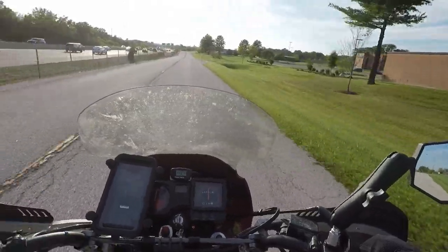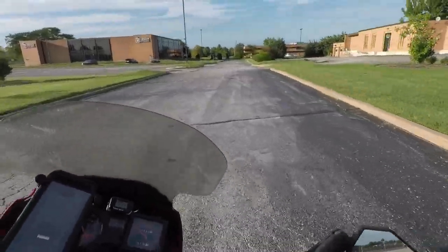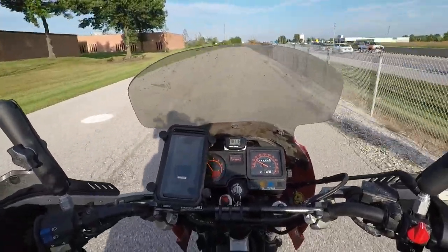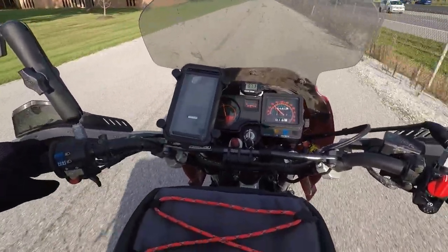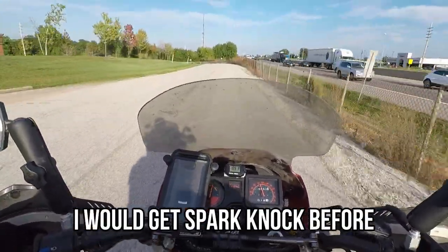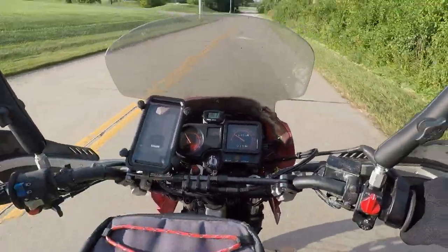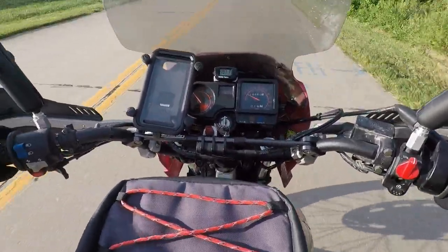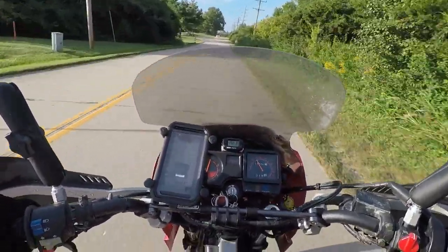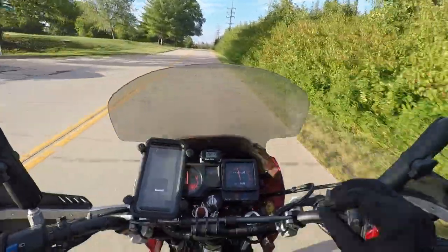That roll-on power actually feels a little bit more smooth. So KLRs don't like being lugged. That is much better. All right, so down in second, not that the speed matters, but we're at 2000 RPM. Usually it would definitely complain doing that. So it just needed that fuel right at the bottom there.